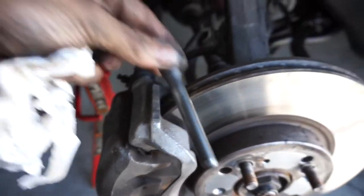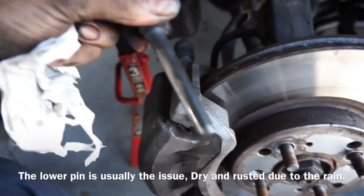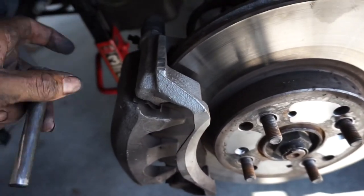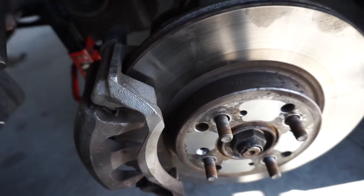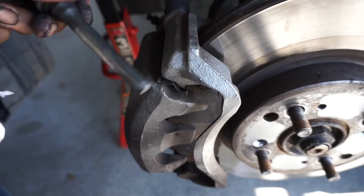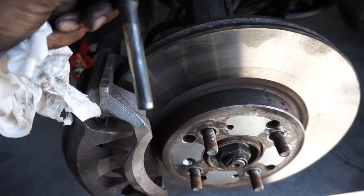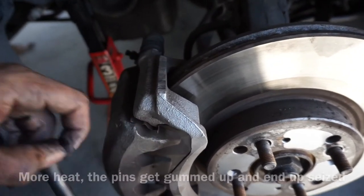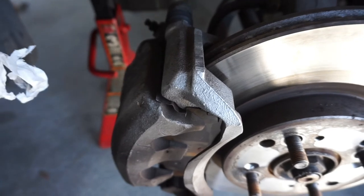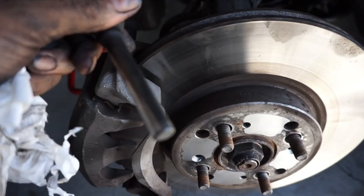I took the caliper sliding pin out and it was pretty grimy. I cleaned it as much as possible and I'm going to put some grease on the sliding pins. I really believe the caliper was getting stuck and overheating the rotor because the brakes were getting really really hot. On the highway you tend to press the brake pedal for longer periods, which heats up the brakes even more than stop-and-go — stop-and-go gives the brakes time to cool down in between. So always check your brakes.